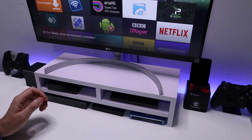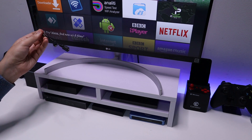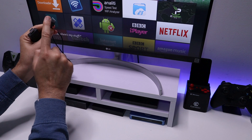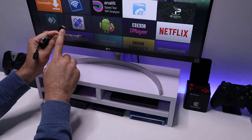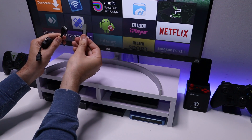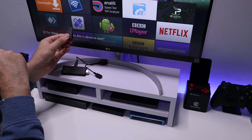One of the biggest issues with the 4K Fire Stick is that it has very limited storage. Fortunately, you can expand the storage using a simple OTG cable. This OTG cable plugs into your Fire Stick where you normally plug in the power cable. On the other side you plug in your power cable, and you now have a full-size USB port where you can attach USB devices like keyboards, mice, or a USB flash drive. The only issue with a USB drive is the performance — it's literally night and day compared to an SSD drive.